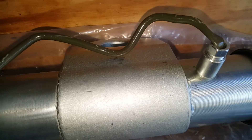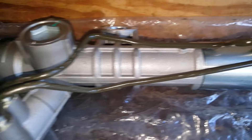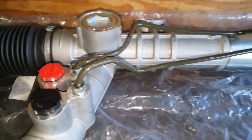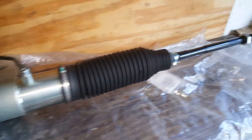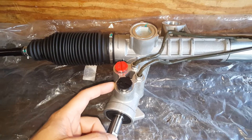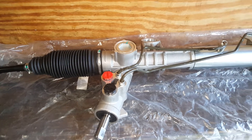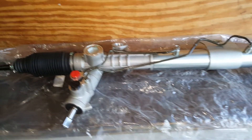Just to give you a close-up look at what I'm talking about — these are completely not usable. Now it's not real difficult; I've swapped these over before. The other thing is the reman didn't come with any new seals for these lines, but it's not a big deal — I've reused the seals before with other rack and pinions and put used ones on without any issue.